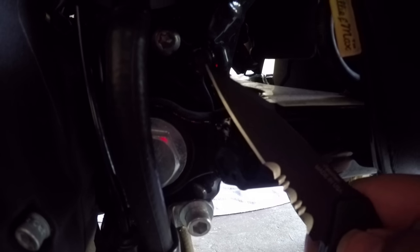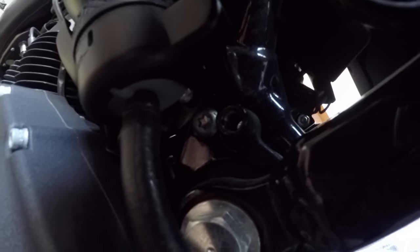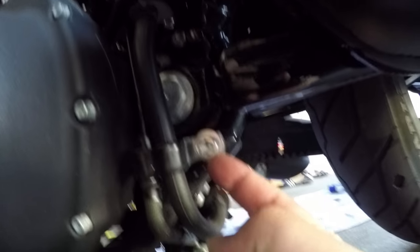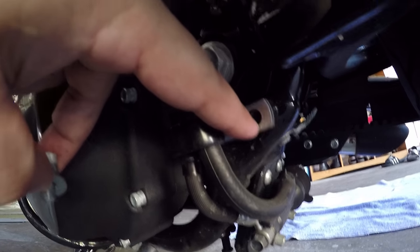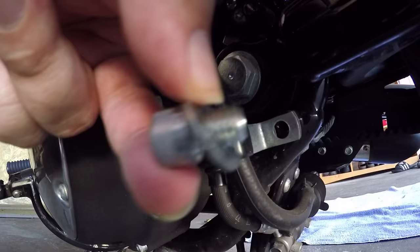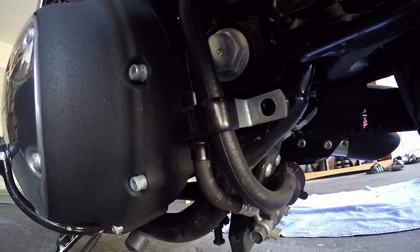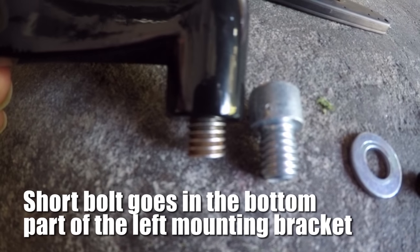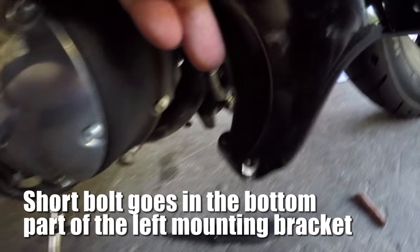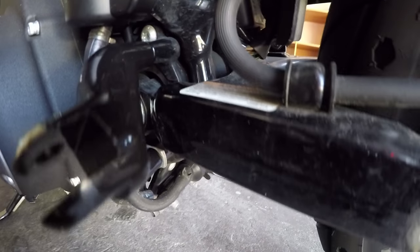I'm gonna face this away from the brake lines. There's the plug, there's the threading, and then you're gonna remove this bracket as well. After removing that bolt, looking at the length of it, that's probably where the short bolt in the kit goes because it's not very long. That little short bolt goes in the bottom part. Here it is with the bracket all installed — I haven't torqued it down yet, but that's what that side looks like installed. Left side is super easy.